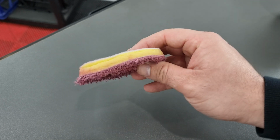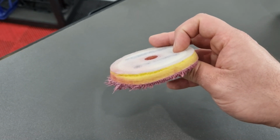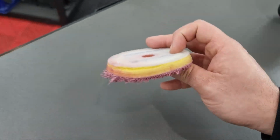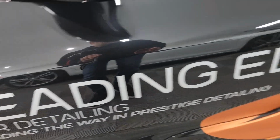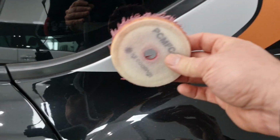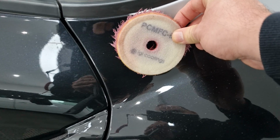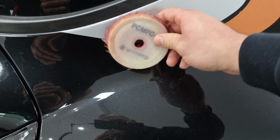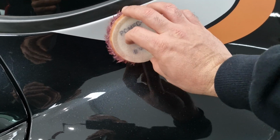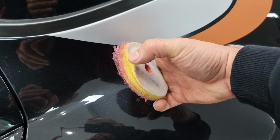So this kind of damage is purely based on technique. And again, let's go back to the Volkswagen Golf. Actually, let's go to the Supra. Let's spice it up a little bit. So imagine you're polishing this section here of the Supra, and you have the 3-inch and it's spinning, and then you start jamming it into this curve. As you're jamming the pad into this curve and the machine is trying to oscillate, it is going to rip the Velcro off.